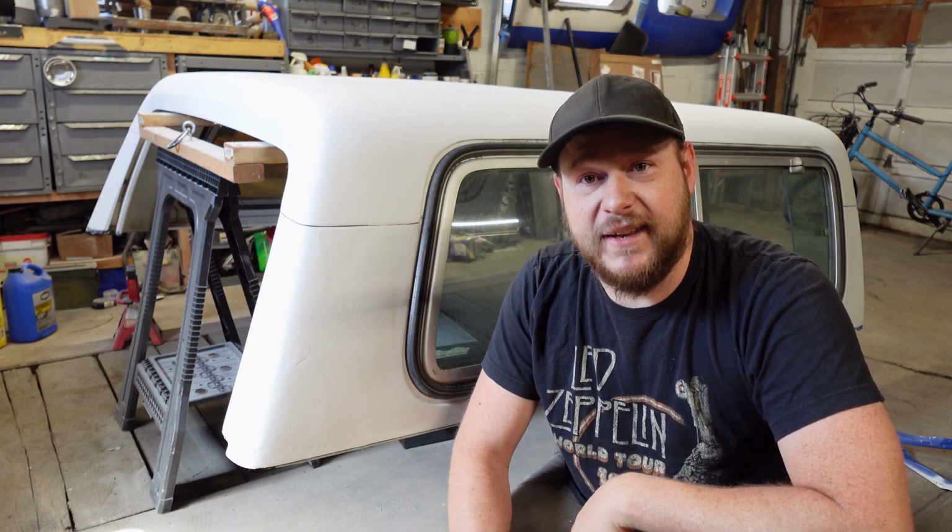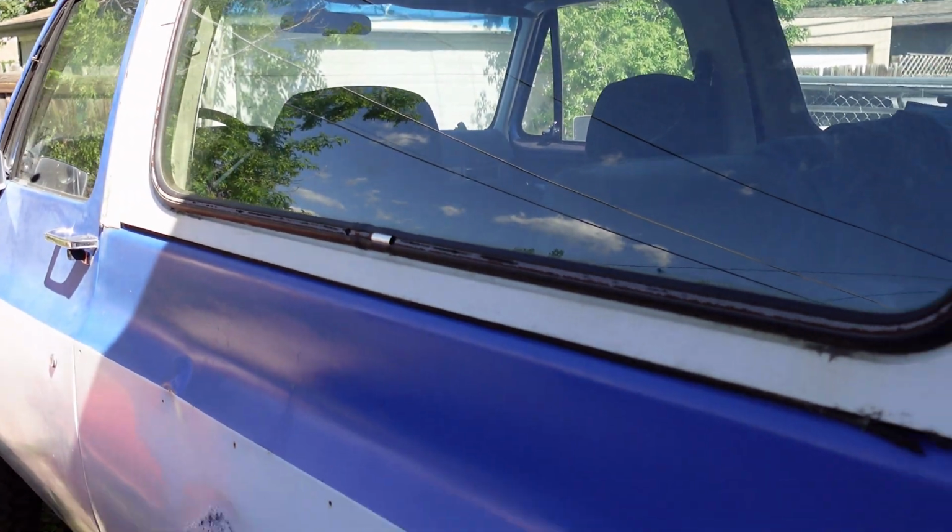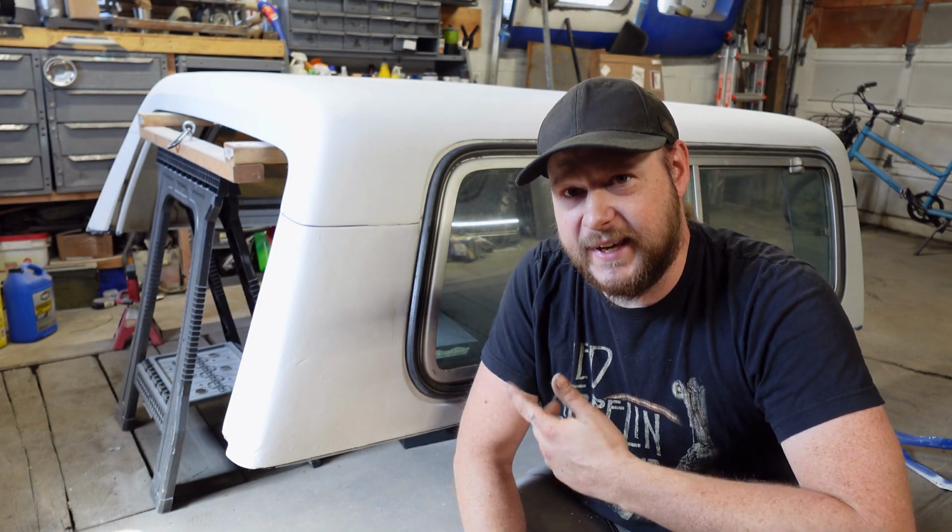And finally, the other thing I could have done is what I did on the other hardtop, which I did just before doing this one. I just took the last step, that flat black or flat white paint from a can, rolled it on with a foam roller, straight over the fiberglass. I didn't even bother trying to encapsulate anything, just stuck paint to the top in pretty rough shape. And it actually looked pretty good. It's not quite as good as this, but it's also a little bit better in other ways. But this will definitely get me by, and again, it does look presentable.